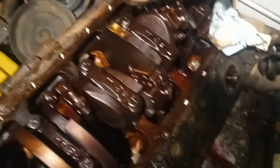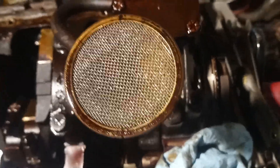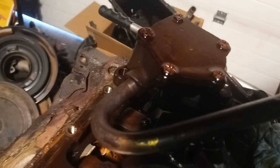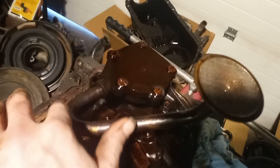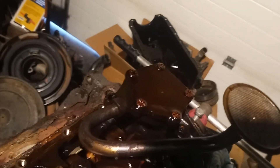The screen looks beautiful — like there's never been anything sucked up through it. It looks like there's a pipe thread on the oil pump itself. I might throw a tack weld on that, just one spot, because technically it could pivot back and forth since it's on a thread. I'll probably just throw one little stitch on the top and call it good.